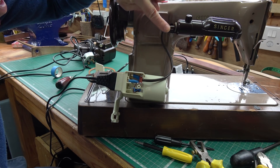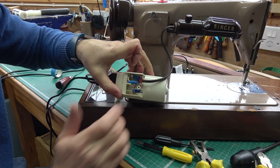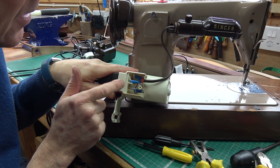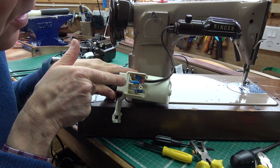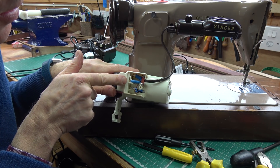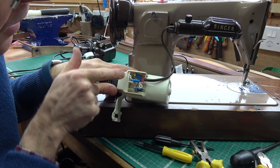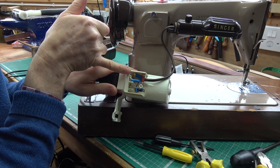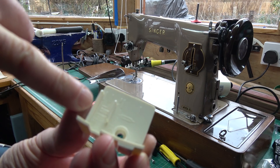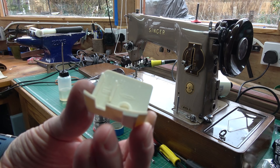I've just been wiring the light into the motor. The kit comes with a couple of crimps so you can put those on the end of the light cable. It unfortunately doesn't come with a wiring diagram to tell you where they should go, but actually the crimps can only go on really in two places. One is on the live where the motor live is, and the other is a spare couple of crimps on the side which are connected. Oh — correction: there actually is a wiring diagram inside the plastic of the lid of the motor housing, showing what the lamp connectors are, which is exactly what I thought they were.